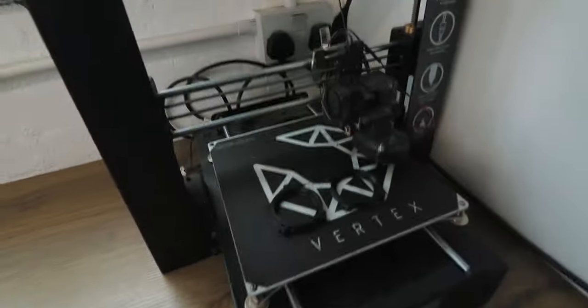I've just taken the tweeter grill off and had a look at the mount — it turns out it's exactly the same as a VW T6. This is fortunate for me because I've already got this design on the computer; it was made to fit an Audison Voce tweeter. So all I've had to do is just tweak it a little bit so it will fit an Audison Prima. They've just finished printing, so I'll get them fitted in a minute.